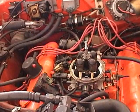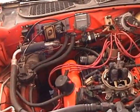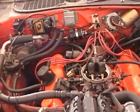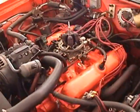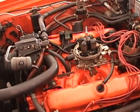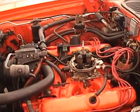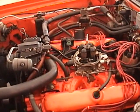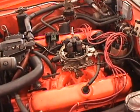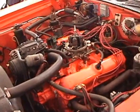I've got a whole other manifold — welded up with bungs and fuel injectors off a 5.2 Magnum, 24-pound injectors at 43 PSI. What's coming out is a 340 I got from a friend. It has low oil pressure; I don't know if something's in the oiling system. I've driven it for about a year and a half and it just goes up and down — lifter starts ticking. I swapped out lifters, push rods, and rocker arms, and it still fluctuates.